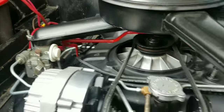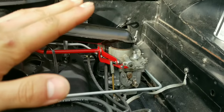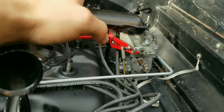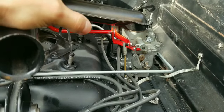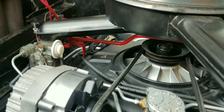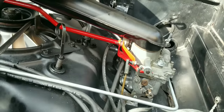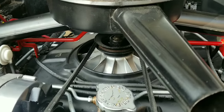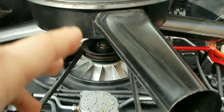In summary, I could not get the carbs to idle — they would only run off the fast idle cam. That means the throttle blades were open enough to bypass the idle circuit, so that's why it would only run there. Once it warmed up and went off the fast idle cam, it wouldn't run off the idle circuit because it was clogged. Basically, the whole time this car's been running, I've had the idle speed screws turned up so I just bypassed the idle circuit the whole time — and that's why it wasn't working with the timing we had set.